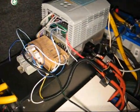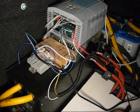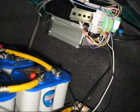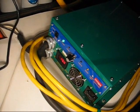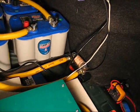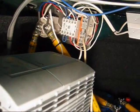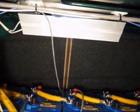So this is what's inside my trunk — that's the inverter that I built, and this is the one that's running sensorless vector. And I have my DC-DC converter, which is a 60 amp Iota unit, and this is my charger. As you can see I'm pulling almost 20 amps at 240 volts. And I have a 300 amp fuse, which proudly has never blown. And then there's my pre-charge contactor, my main contactor, and my pre-charge resistor.